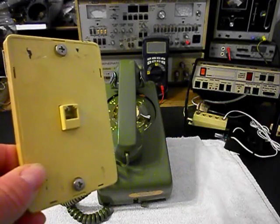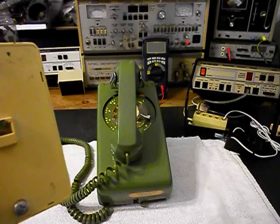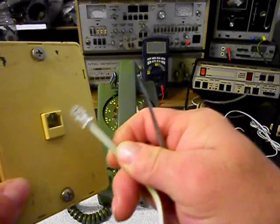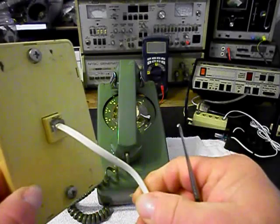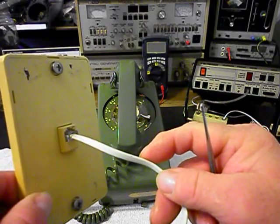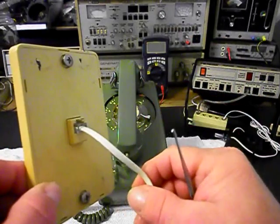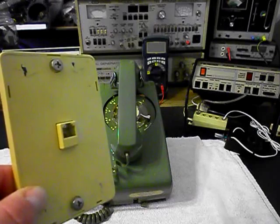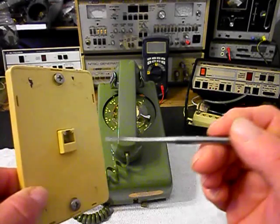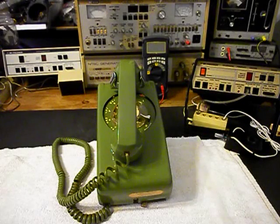So basically what happens is with a modern day telephone, you would use a little stubby modular cord that's a couple of inches long and one end would be plugged into the telephone and the other end would be plugged into the jack. They curl up what's left of the line cord and usually they're very short to begin with, and then you can hang the phone on the jack. So we're going to be doing a conversion on this telephone so that it will accept a more modern style wall jack.